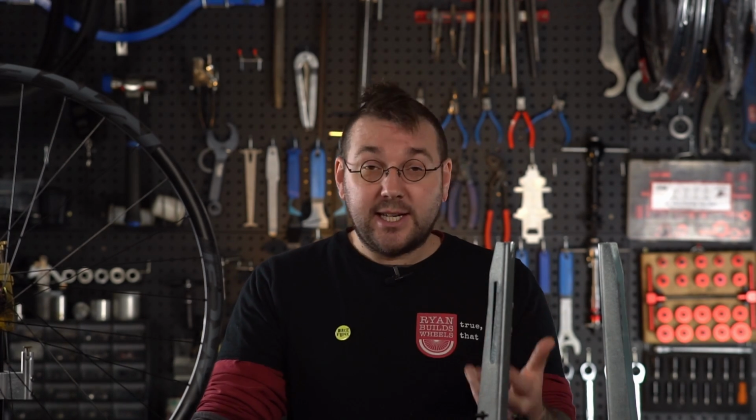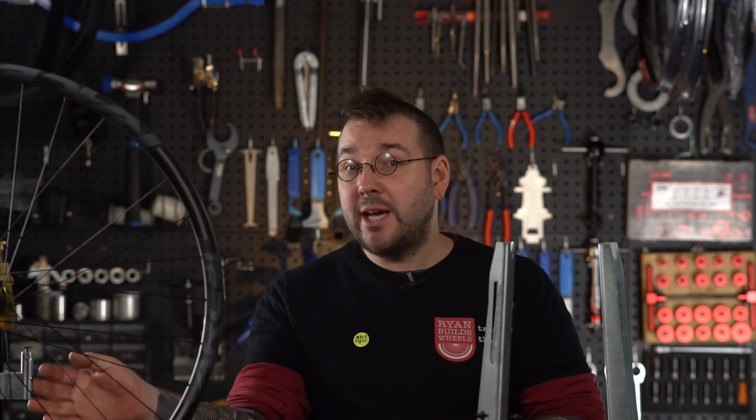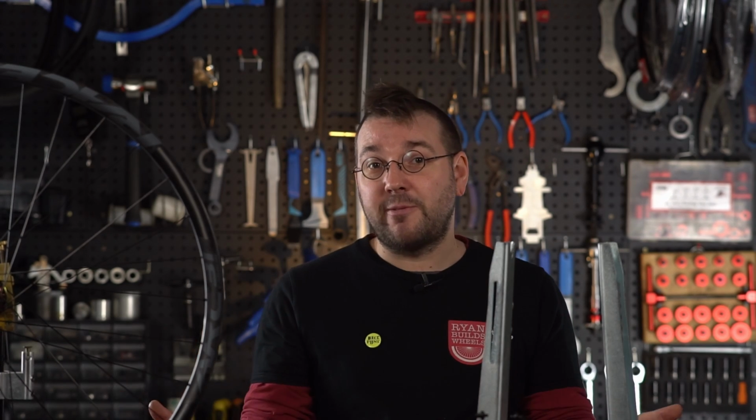So in this episode, I'm going to be teaching you all about truing. What is truing, I hear you ask? Well, truing is merely the process of making a wheel straight. And once we have calculated our spoke lengths, laced our wheel, got it all assembled, then the next thing we need to do is start truing it. And the way that we're going to true the wheel is basically by changing tension within the spokes to make it either go left, right, up or down until you've got everything nice and true.